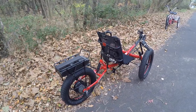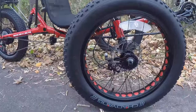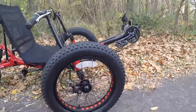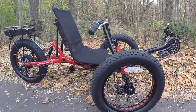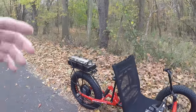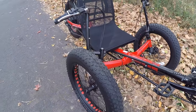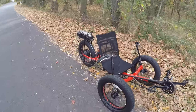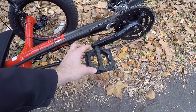Even if this didn't have suspension, the four-inch-wide tires — these are 20 by 4 — give you a lot of cushion. Maximum inflation is 20 PSI. I've seen a lot of fat bikes rated 5 to 30 PSI, so I definitely wouldn't go over 20 on these. If you're on sand or snow, dropping the pressure down gives you a larger contact patch for better traction, spreads out your weight, and helps you not sink in as much. Those are some fat bike-specific tips.